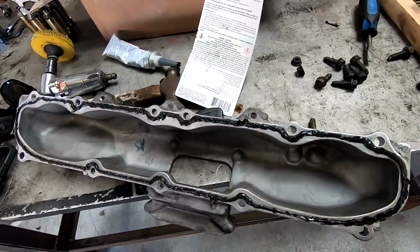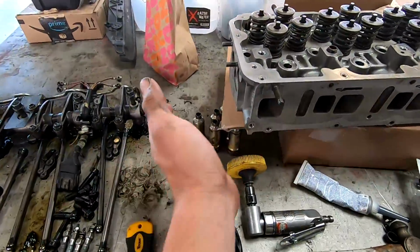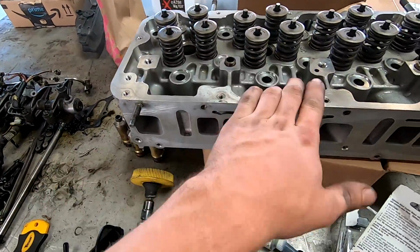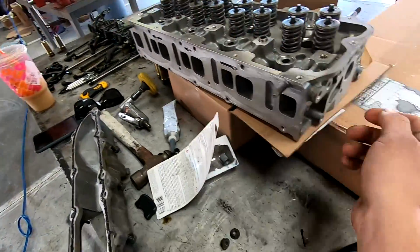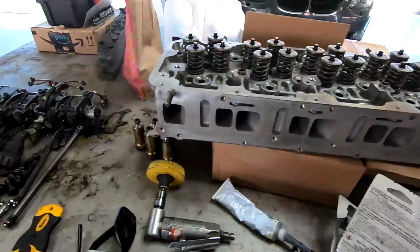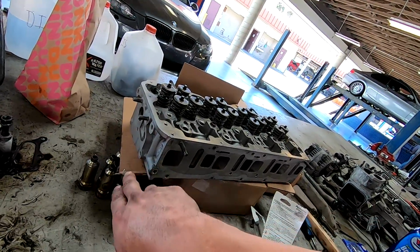We'll throw these two on. It goes on the stud, so it's pretty easy. Now you want to make sure they are labeled. So your right side head, obviously the push rods are towards the top. If the motor's forward this way, you've got your right side head, because the back side coolant passages are plugged on these, and your front side's open, so that's where your coolant Y bridge or coolant crossover tube goes.